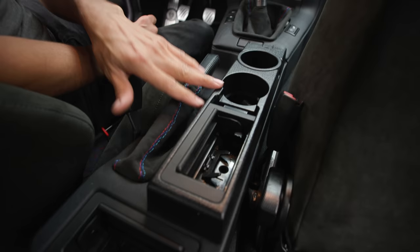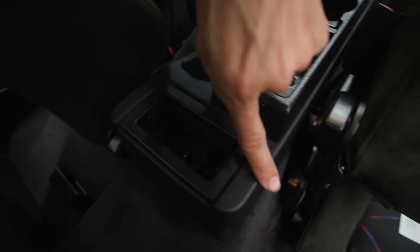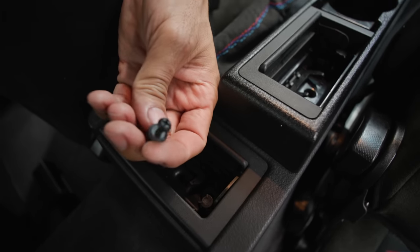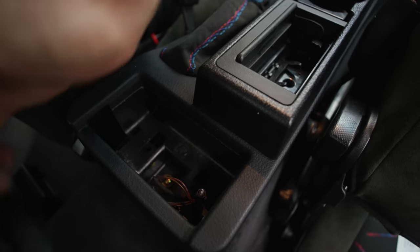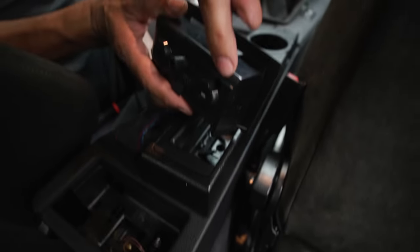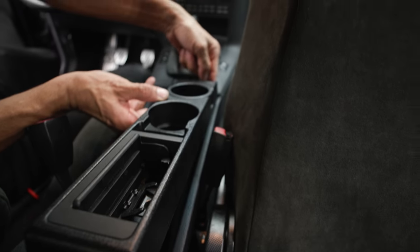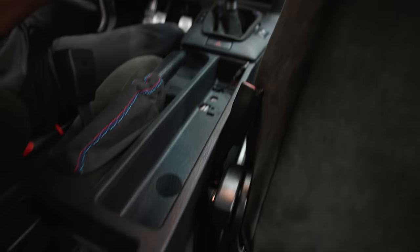For the handbrake, this one is just a tad bit different. What we've got — right in here when you remove the ashtray itself — you can see there's one ashtray already there, and then I have the front ashtray down towards the bottom. You just slide out both ashtrays. Then on this one there are Phillips screws — plastic ones that just screw out, be careful. Those two come out, and then this tray just pops out. There is a light right here, and the light goes right into that small little hole — it just slides right on out. Same thing for the front ashtray — there is a slot where the front goes in, and there's also a light down there. Light is out and this piece is now completely out.